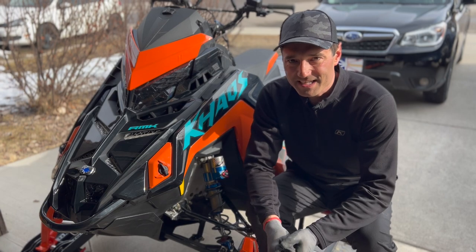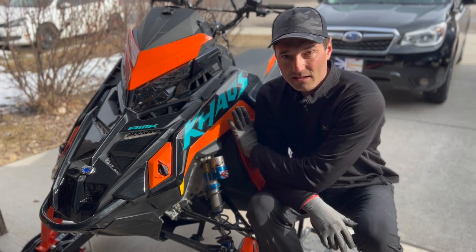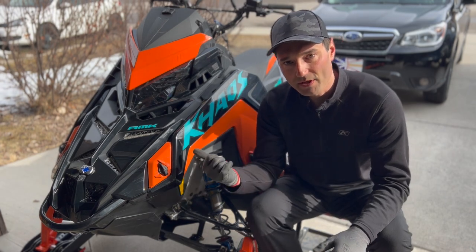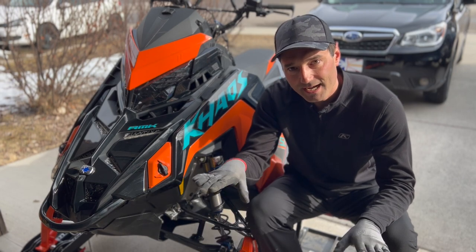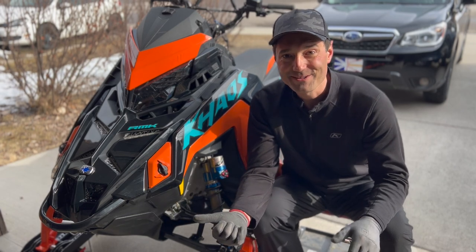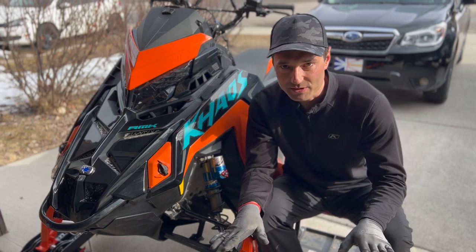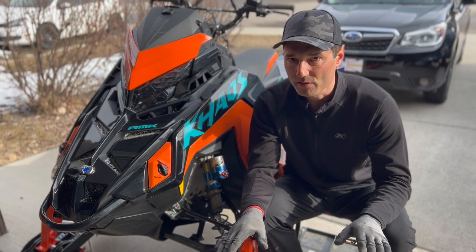After using a couple of different scales and going back and forth measuring each side as much as I could, the clutch side is definitely lighter than the exhaust side. So the question was: if I swap out the heavy stock silencer for a lightweight silencer, will that make the right side lighter than the left and affect the weight distribution? Turns out the right side is already heavier than the left side, so going to a lightweight silencer is going to improve the weight distribution — the right side will be closer to the left. It will still be heavier, but it will be better.